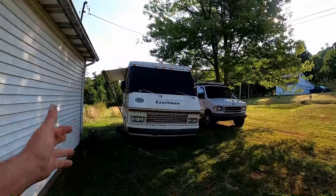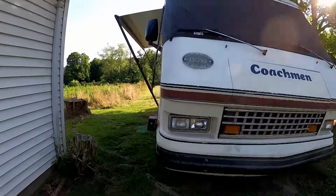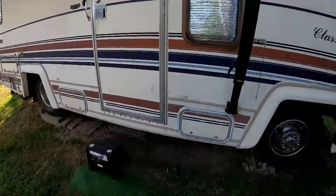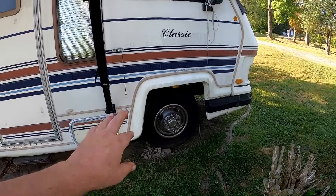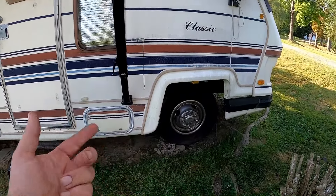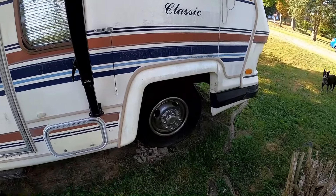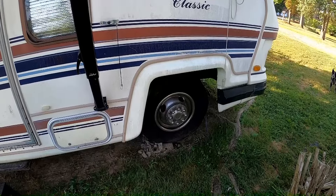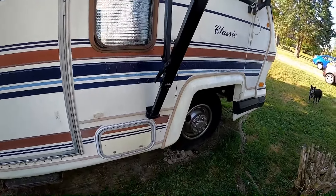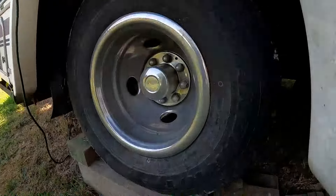With the Coachman, the other big job is I need to go over all the brakes. The front ones were new when I bought it, but I want to check the brake pads because they're the big wear item — they're getting thin, starting to get a bit worn. If they're 50% or more worn, I'll just put new pads on it. It's cheaper to put new pads on than to wear them all the way down and ruin the rotors.